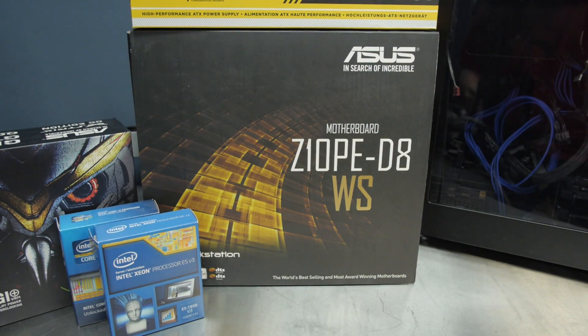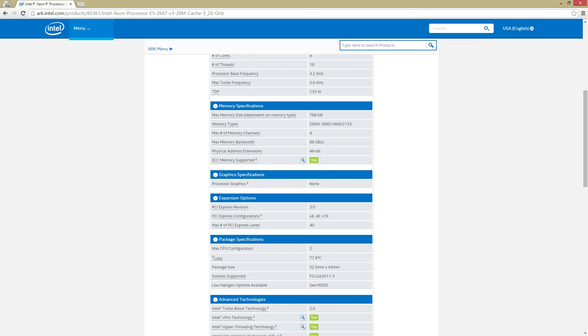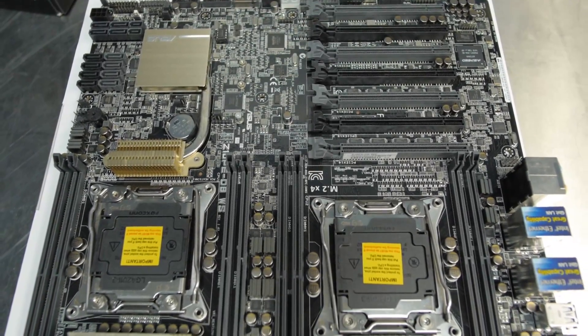For testing purposes I'm using a Xeon E5-1650. Now, 1600 series CPUs don't actually support operating with more than one socket — if you get two 1600 series CPUs, that won't work. You'd have to get two 2600 series Xeons. The first number in Intel's naming convention basically tells you how many sockets the CPU will work with. There's also an interface between CPUs called QuickPath — QPI — which is a very high-speed interconnect designed for inter-CPU communication, not unlike the memory bus. The motherboard real estate is basically dominated by the CPU and RAM slots.